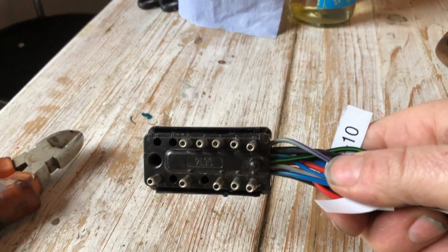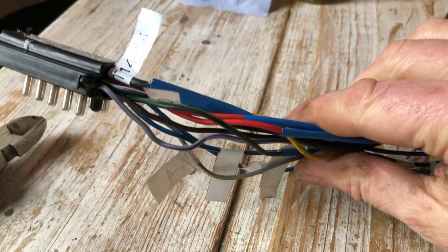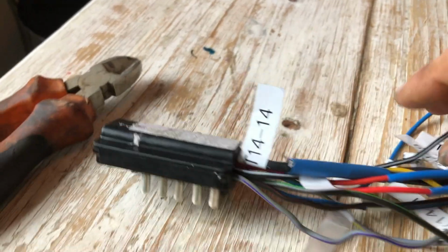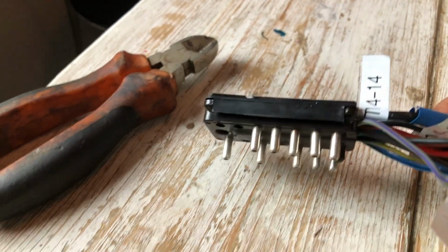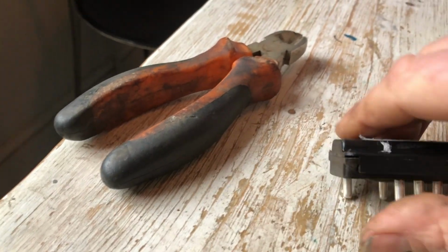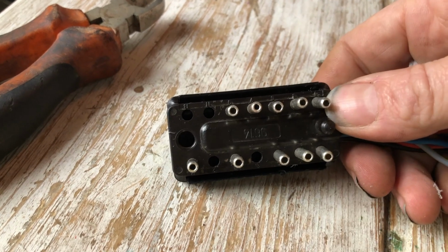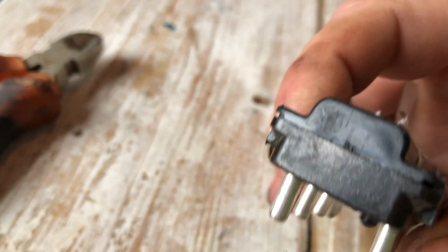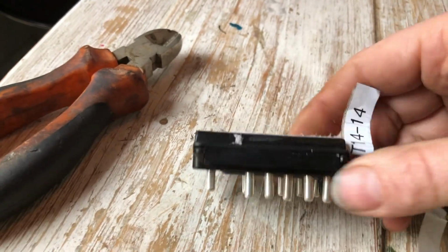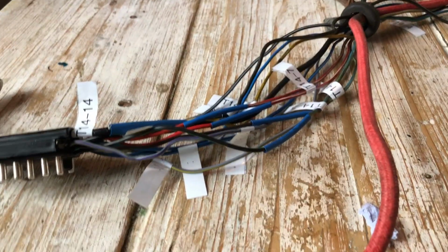Caps on. Big old spaghetti mess coming out the back. I need to get the heat gun on these heat shrinks where I've spliced in these new connectors, but it's all good. It's all really quite satisfying. Again, I need to double check all those pins and things, but they're in there. The 40-year-old connector is clamped back up, and I can work my way from here back down the loom now to neaten things off.